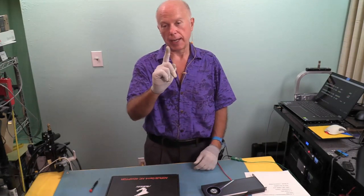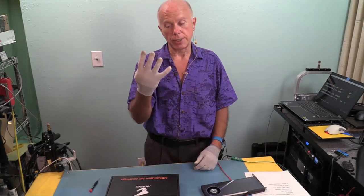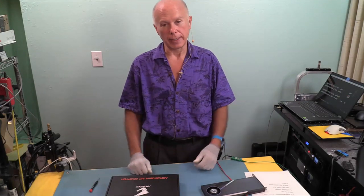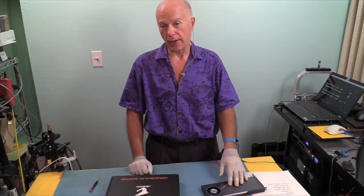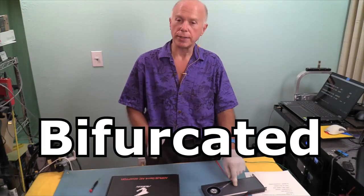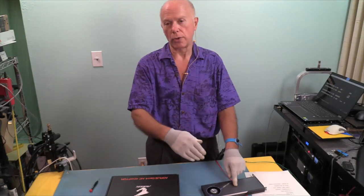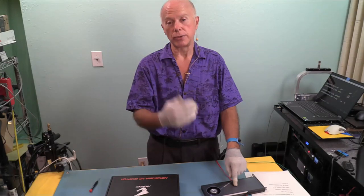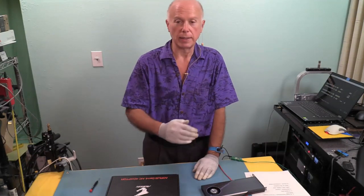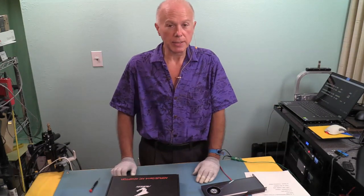You've got one 16-lane slot. Now, you may have three or four slots that are 16-lane mechanically, but you've only got one 16-lane slot electrically. That would be the first slot. And the X570 chipset can handle one of these bifurcated. Now, PCI Express 4, it's supposed to be automatic. If we have a problem, when we go into the BIOS, we'll see the controller. We'll see the drives on the controller. If we don't, then we need to go into the BIOS while we're there and manually set it. Because the BIOS is beta, we'll see. But that's the way it's supposed to happen.